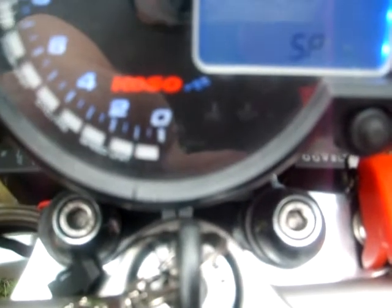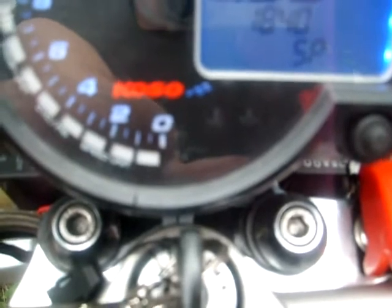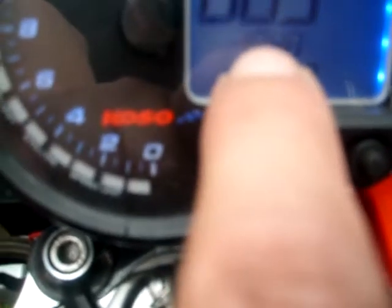Next one is temperature again. That must be your oil temperature. Yep, that's your oil temperature, I think. No, that was your water, sorry, that's your oil. That's my wheel. So I've got that set at 1840 millimetres. So that's my front wheel setting. That's the circumference of the wheel. And I've got 5 pickups on there, so I'll show you in a minute.